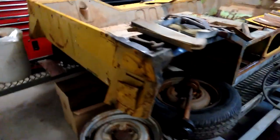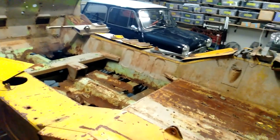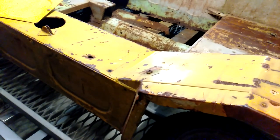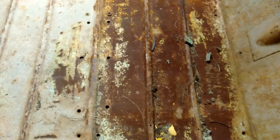Just on the rear there's a few dents that need panel beating to take out. The actual body of this is just like working on a box trailer — compared to the Morris Mini, that was a lot more effort to get the body and surface right. Because of the way people modify and use Mokes, there are various holes in certain spots. I need to work out whether those holes need to be filled or whether they're original. You can see holes that don't line up, so maybe it was modified to have a seat put in the back. I need to do a bit of research and work out which holes should be there and which ones need to be filled.